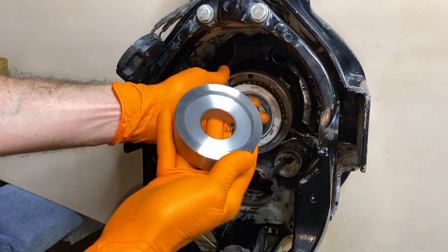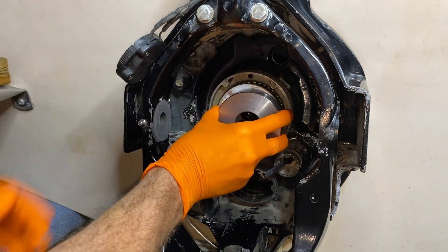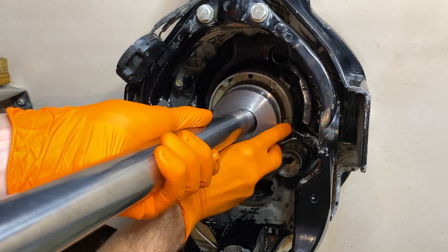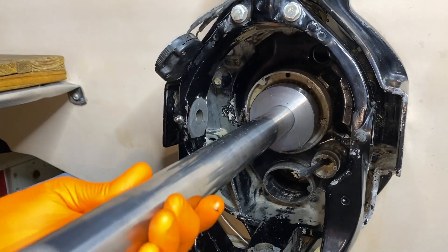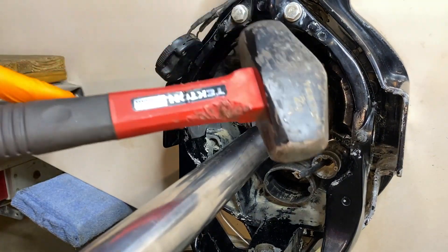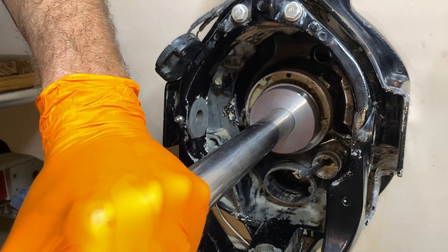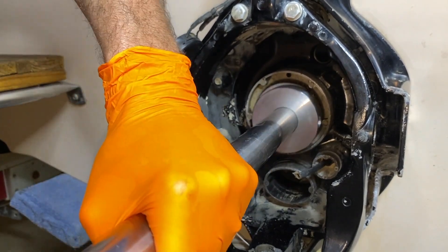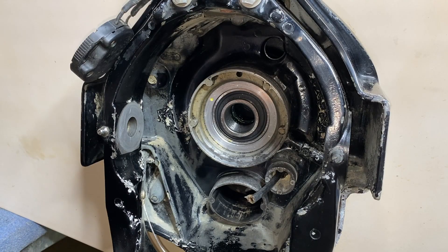Do your best to get it in as straight as possible. From here, I will grab the adapter — specifically machine cut and designed for your gimbal bearing — and slide that in place. Now to the driver rod. I'll shift the camera just a bit and I will begin hammering this in with my two pound Tekton hammer. Making huge progress — that gimbal bearing is properly seated in the housing.